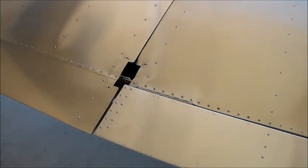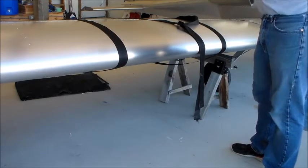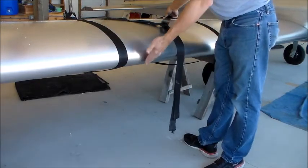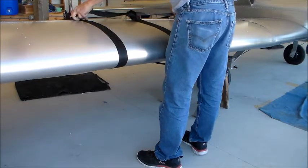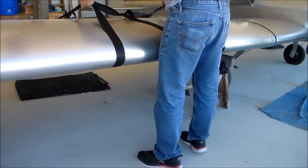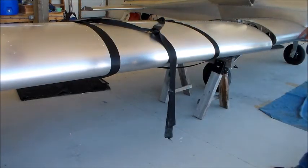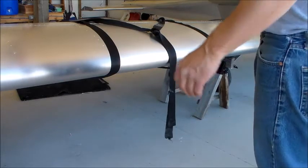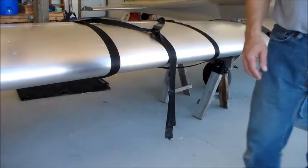Next I'll slide the wing apart and then remove the aileron control rod. This is why I set up that webbing earlier. I'll grab these two straps and place my legs against the leading edge to support the wing, then I'll slide it out so that I've disconnected it from the spars. And that's why I put the sawhorses there, so that when I move it to the left the wing will be supported on the ribs.